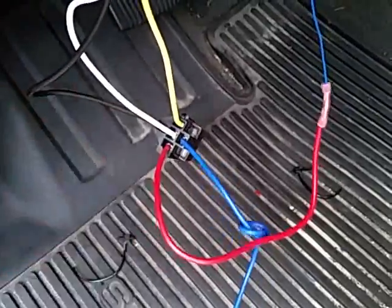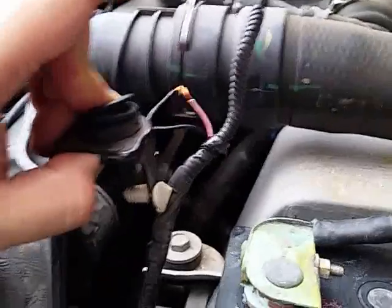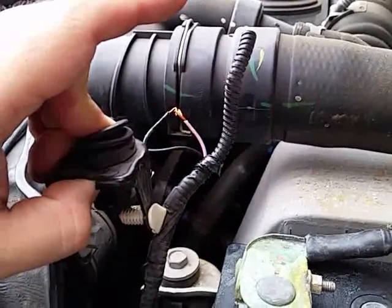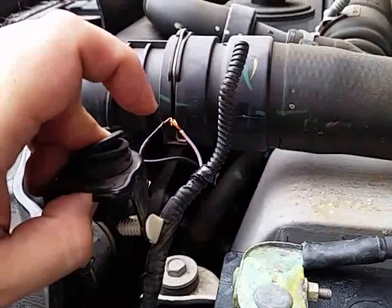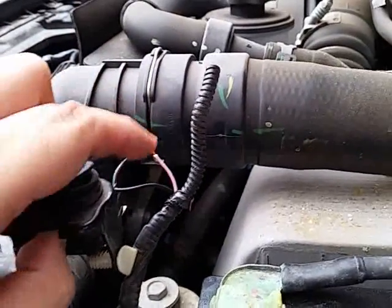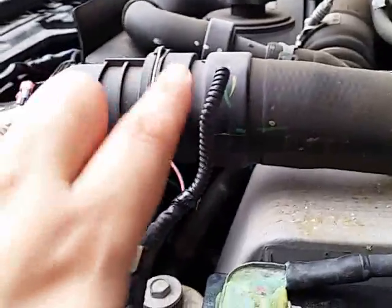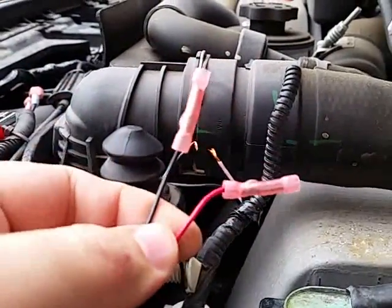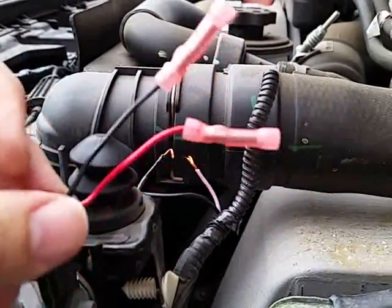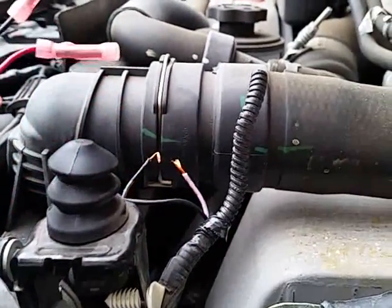I'm going to wire all this up and be back. Now I've held this hood pressure sensor down for about 20 seconds — watch what you'll see. I'm basically just proving what I'm talking about here. When I disconnect these two leads right here, the alarm's going to go off. So now I'm going to connect these two connectors, one on each side, and that relay I have wired inside the cab will do the same thing — it will split that wire, thus setting the alarm off.